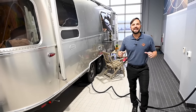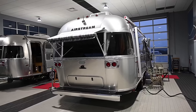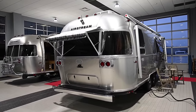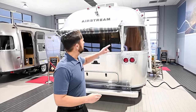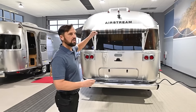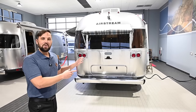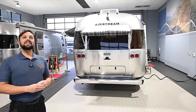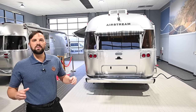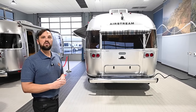The model we're looking at today is a queen bed, but it's also available in twin. This trailer is 28 feet 2 inches from the ball to the bumper. It is 8.5 feet wide, giving an interior width of 8 feet 1 inch. To the top of the air conditioning it is 9 feet 7 inches, and your interior headroom is 6 feet 7 inches. This trailer has a gross vehicle weight rating of 7,600 pounds and a dry weight of 6,825, giving you 775 pounds net cargo carrying capacity, and the hitch weight is 925 pounds.